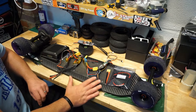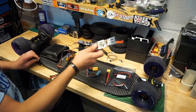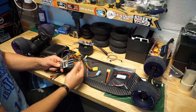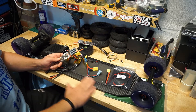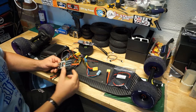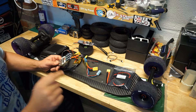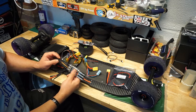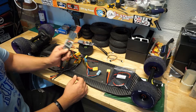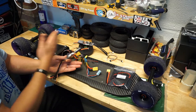Before we start, just quickly the basics. Motor cables go from the motor to your speed controller, your ESC or your VESC. Every VESC will require power which will be coming from the battery located under your deck, on top of your deck, or in your backpack — yes it is an interesting concept and yes I have done it and it works really well. Take a look in the description below for a link to the video of my beast with batteries in a backpack. You have to break the connection between your ESC and the battery when the board is not in use, because otherwise power will be constantly going into your electronic components.